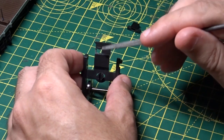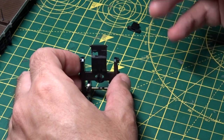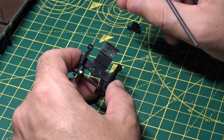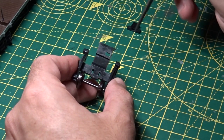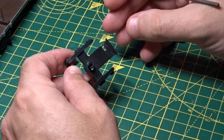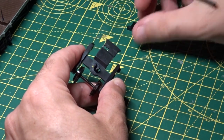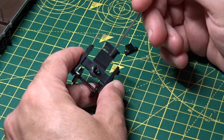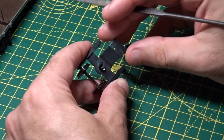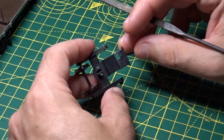And then you need to cut a channel down the center and also into this panel here. So actually the pocket will go back far enough, and I've designed it so it will go back far enough that it won't foul the axle. So what I'll do is I'll remove this piece of plastic with a disc cutter, then I'll mark out where the pockets will fit into. So I'll be cutting a channel here and then going into this part here. So I'll cut that out, file it and clean it up, and then we'll be back again to show you.